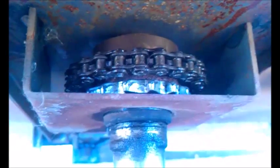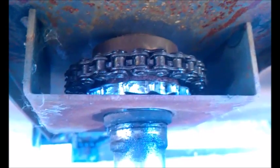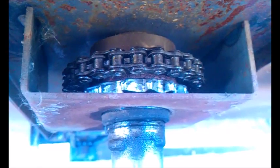Well, I think I can give you a better example because I had to take the whole panel off. I just drilled out 5 rivets on the top and peeled it off carefully. So with this, you can see that gear system really well. The silver one inside is the locking mechanism to keep the roof up. Then you have that little piece of brown, which is the brake, and then you have the chain, which is on the chain sprocket, which is the whole back thing. Now the chain sprocket is held in place by 2 pins. You can just barely see one of them that goes all the way through.